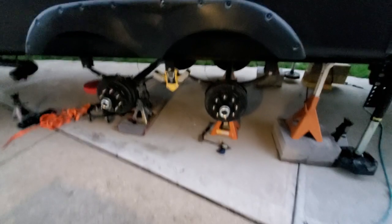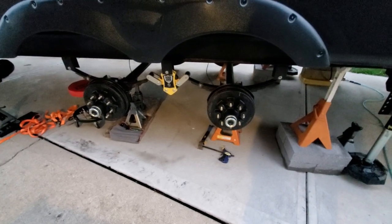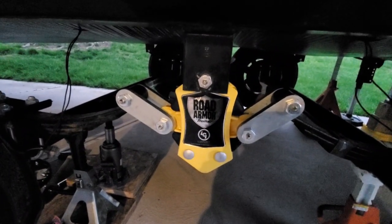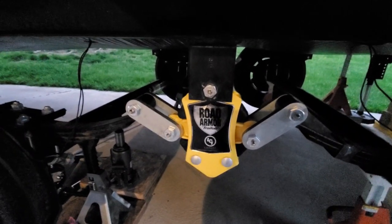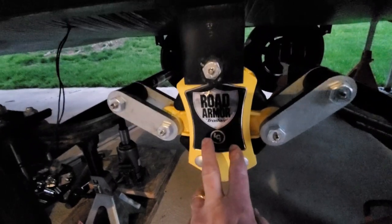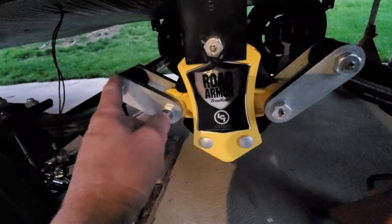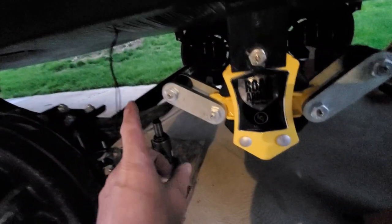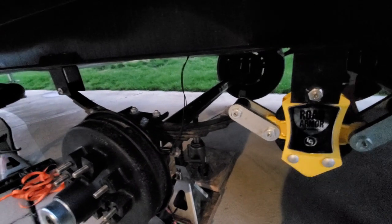Things went late into the evening finishing up the left side suspension. We've got the greasable wet bolts in our shackle hangers now, and we replaced the plastic nylon bushings with bronze. We've got our Road Armor suspension in with our new longer three-and-one-eighth-inch center-hole-to-center-hole shackle straps, and these are also wet bolts. The Road Armor comes with bronze bushings in its mounts, so you don't have to worry about that — you only have to replace what comes in the cheap springs that Lippert provides to Forest River.